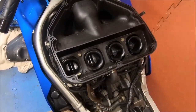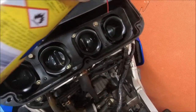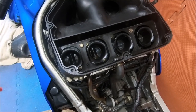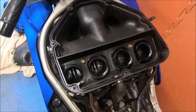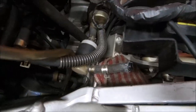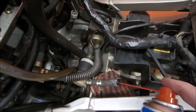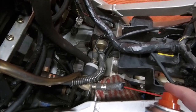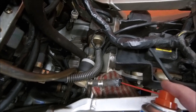I'm quite aware the internet's going to shout at me and tell me I'm doing everything wrong here, but when it's been off the road for a while I like to get the pen and give it some in there — get inside the pilot jet holes as well and give them a blast. That will go into the carbs and into the engine itself. Yes it will smoke when I start it up, but at least it's got some lubrication — not the right lubrication, but it's better than nothing. Everybody's going to tell me I'm doing this wrong — but my bike! A little bit of carb cleaner down into the fuel inlet there, then I'll put the pump on, let that go through the carbs and settle in there to start breaking down any furry stuff. I'm going to run the bike — not start it at first — just to run that through the system.